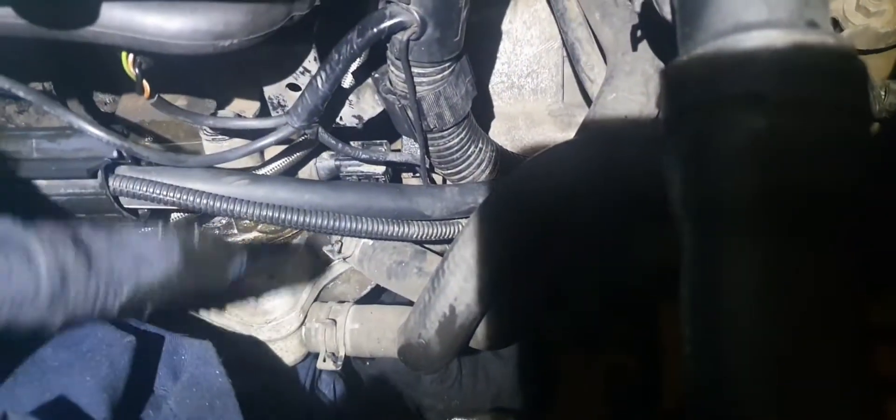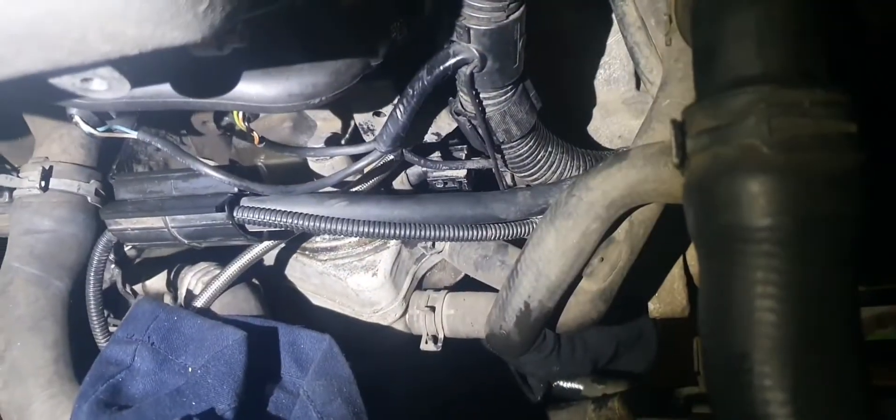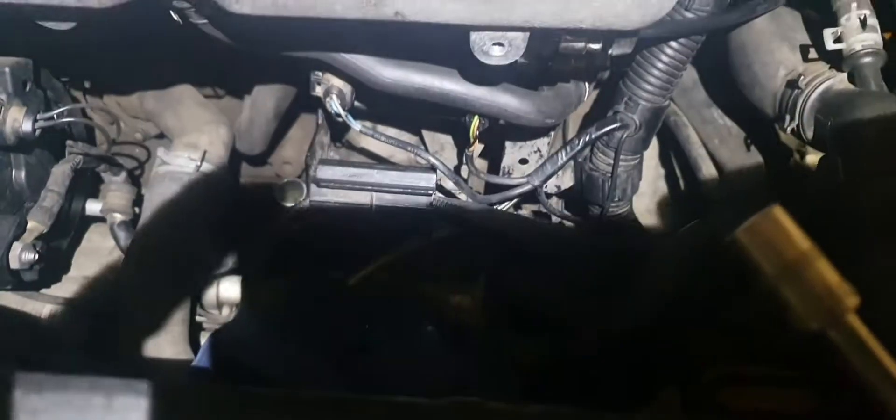So there's one, two, three and four bolts behind. I've got this spare unit that I just cleaned. To remove all of this, you're gonna have to remove the oil filter housing and the oil cooler as well. Then there's four bolts. I need a 27 millimeter socket — I'll get that tomorrow. There's a bracket which I'll take off. Cross-threaded the oil feed. Definitely fun times.